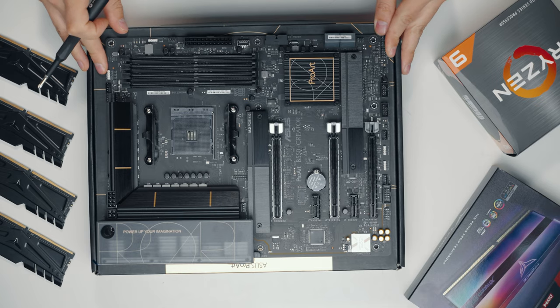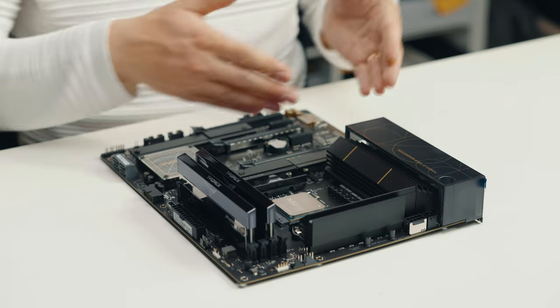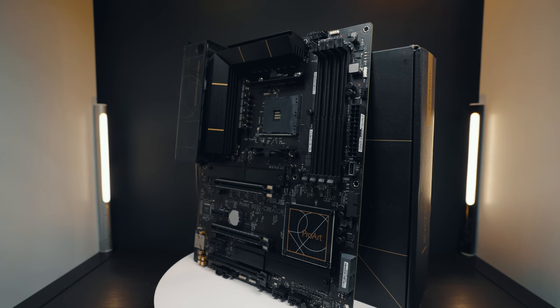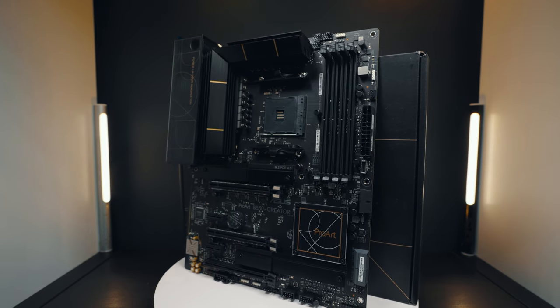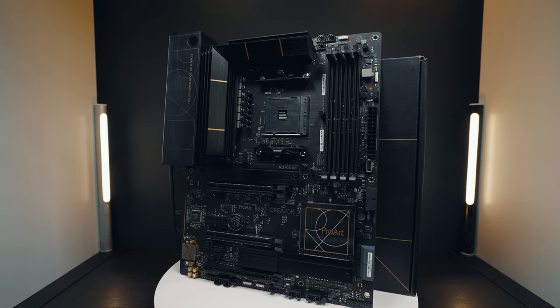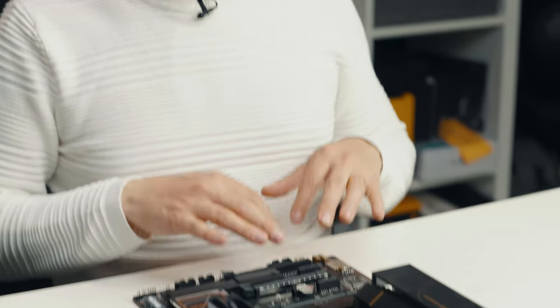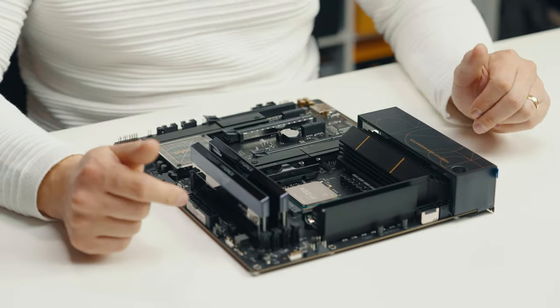There is no WiFi and Bluetooth on this board. Even though the Thunderbolt 4 is absolutely amazing — think about all the external hard drives, monitors, and docks you can add — there's no wireless built in. You could get a Thunderbolt 4 to 10 gigabit ethernet dock if you need faster networking. But for Bluetooth keyboard or mouse, you'll need to use one of the USB ports and add a separate Bluetooth and WiFi card. I'll leave a link for one in the description.